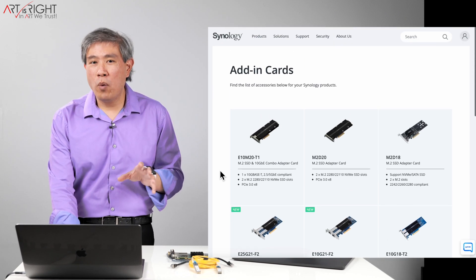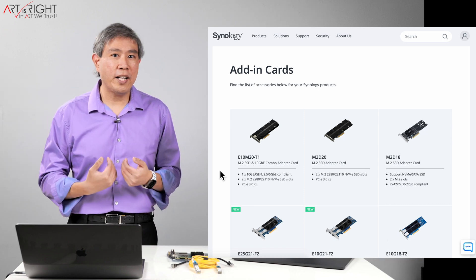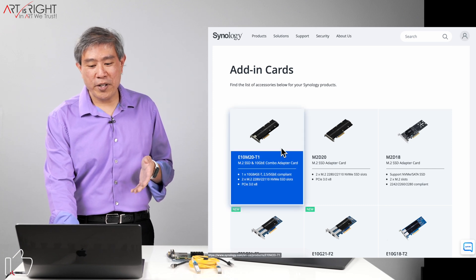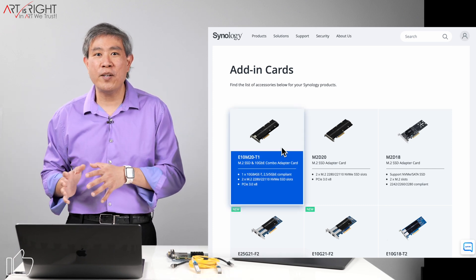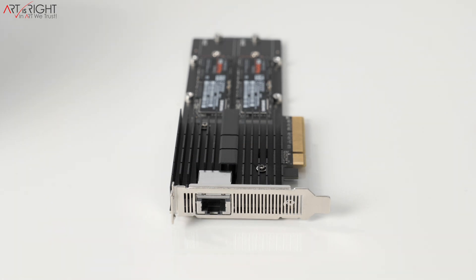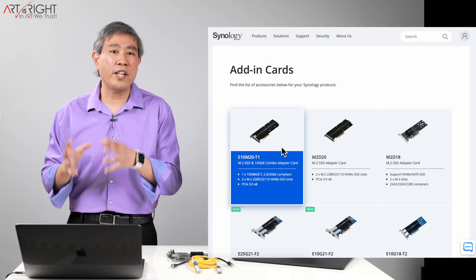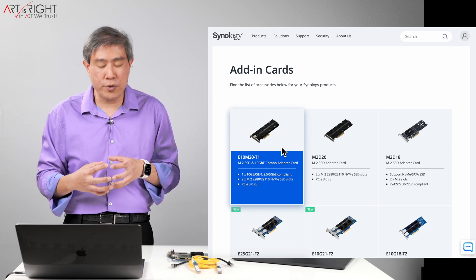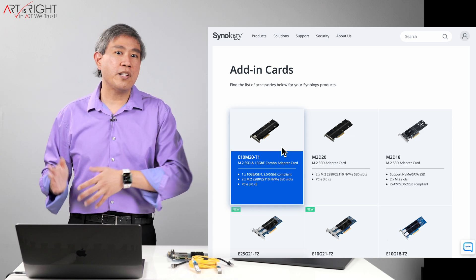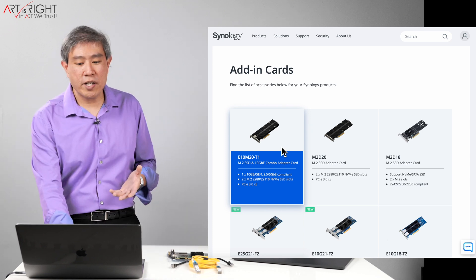However, the reason why you may want to consider a Synology card is that if you have a NAS that does not have a built-in NVMe slot but is compatible with an add-on card that can do NVMe SSD — such as the E10M20-T1 that I'm highlighting on screen right now — this is the one currently installed on my NAS. I have two NVMe blades installed on it, and on the back it has one port for 10 gigabit 10GBASE-T RJ45 networking. This is the reason you'd want a Synology card — they make these combo cards. However, if your NAS has NVMe SSD built in, or you've dedicated slots for SSD caching and don't need a PCIe card with NVMe, then you don't have to go with a Synology card.